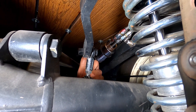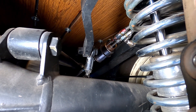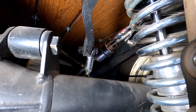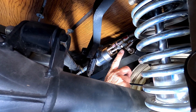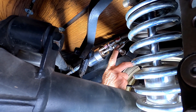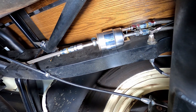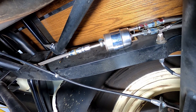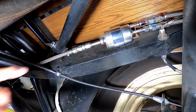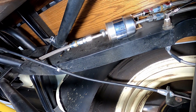The reason for that is because the old regulator was defective inside. A lot of people say it's supposed to be a lifetime deal, but I guarantee you they don't last for a lifetime. These are special fittings on here — you can look them up so you can hook AN lines on here, and several speed shops sell those. It took a while to figure out that was my problem. I also had a little bit of a problem with my in-tank fuel pump — it was real loud, and I have a feeling it was going out because of this.